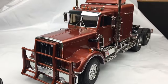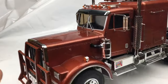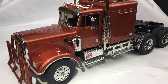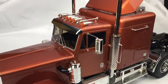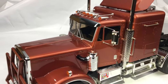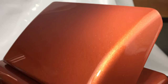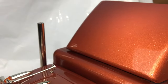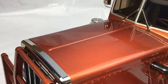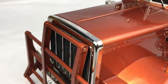That front turned out really well — really shiny and really nice. It's got a lovely finish to it with no orange peel anywhere, because it's all been flatted down with 2500 or 3000 wet and dry, then cutting compound, cut back, and then polished up with resin polish.